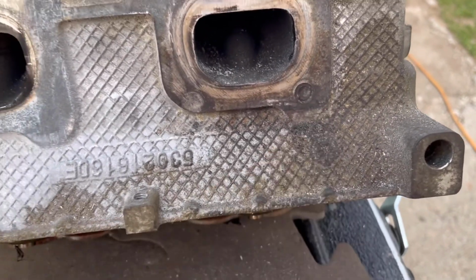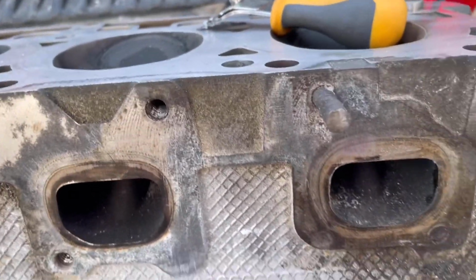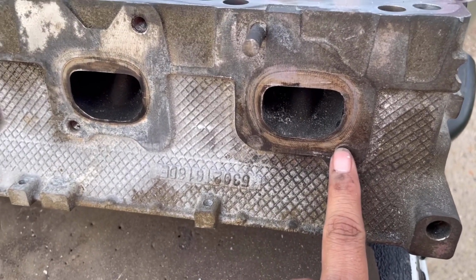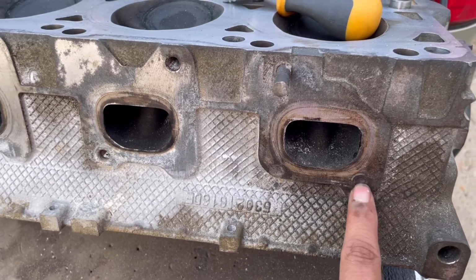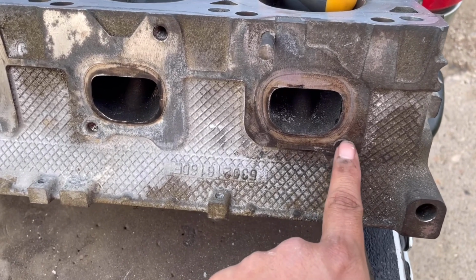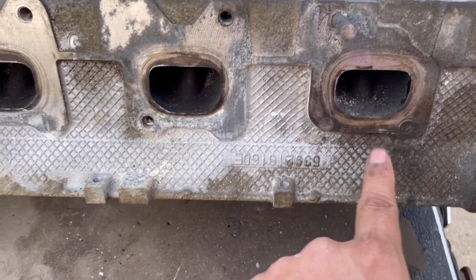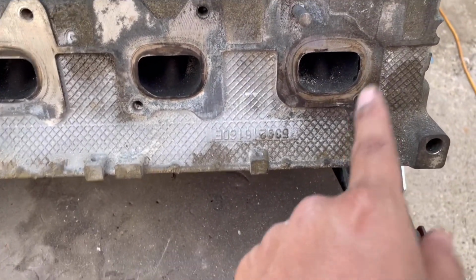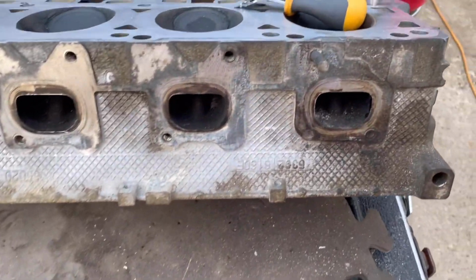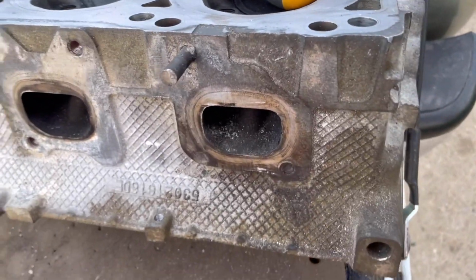But if you look, that's the bolt that literally has been there for years, and you can tell because the thing is black. It looks like it's never been touched. And then the bolt on the top, that's the one I snapped when I didn't do what I was supposed to do, and that's go back and forth. But yeah, guys, I've seen two types of forms to remove this, and one is to get a drill bit and reverse it and pull it out, and the second one is just to weld a bolt into it and thread it out. But you'll see in the next video.